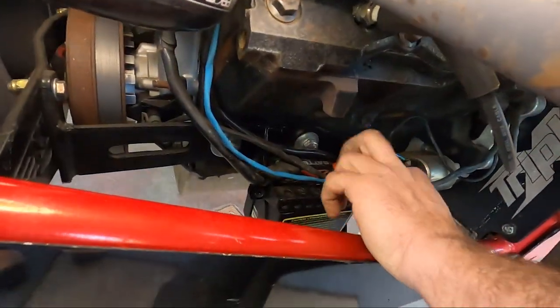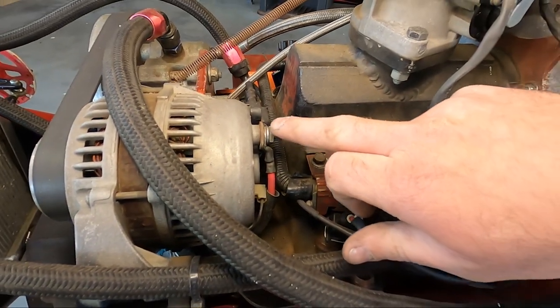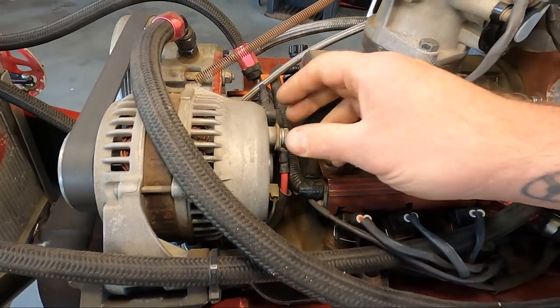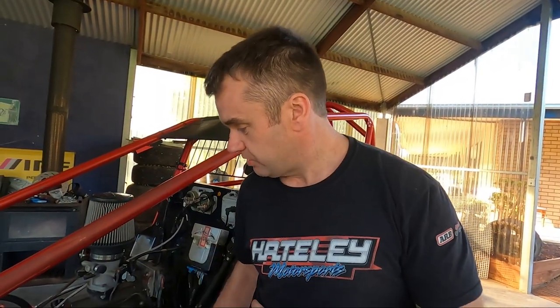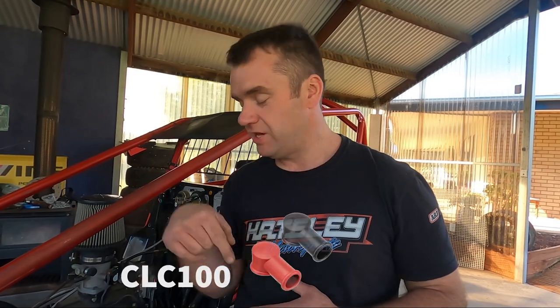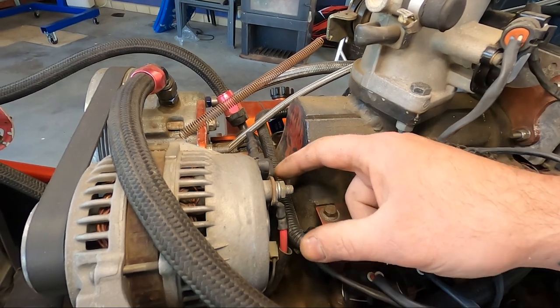It needs to have the terminals covered with the rubber boots. While we're talking about rubber boots, you also need to have one on the back of the alternator — and mine's missing. I've put a new wiring loom in this car to fix some problems from the end of last season, and I obviously forgot to get a boot for that. I better get one organized. I get a lot of people telling me they can't find those rubber boots. They're not impossible to find — there is a part number. If you ring up Repco they might not know what you're talking about, but I'll give you the part number and write it across the bottom of the screen. Just go into Repco, give them that part number, and you'll get them. I think they come in a pack of two, red and black, and they're not very dear. You'll also need to insulate your fuel line — I've just got a bit of conduit, a lot of guys use a bit of fuel hose or heat shrink, whatever works. Mainly so when a car ends up on top of you — which does happen, I've had three cars in the last two seasons end up on top of my car — if they smash that alternator off it'll short out in the back of the fuel rail, melt a hole in that aluminum fuel rail in about two seconds, and then you'll have a pretty good barbecue.